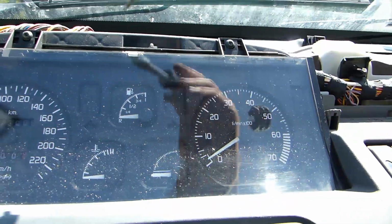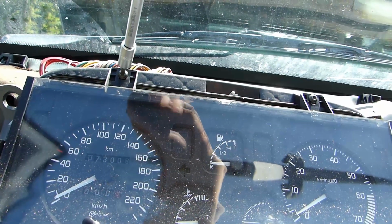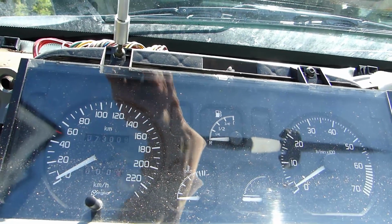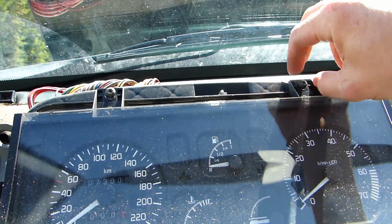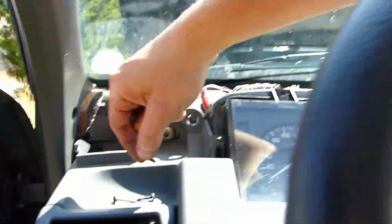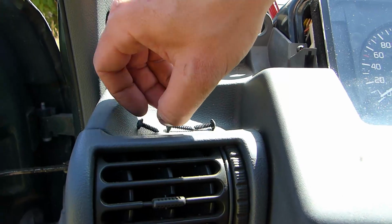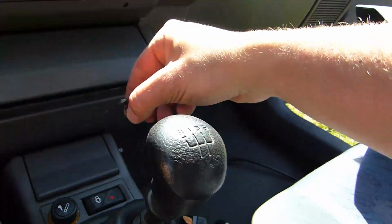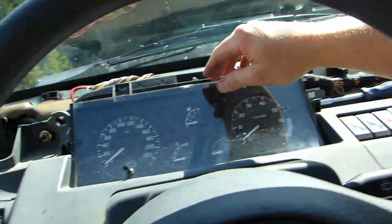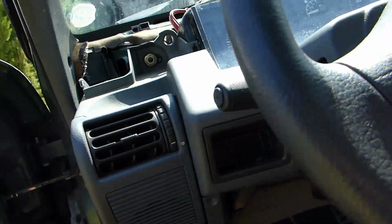And then, see, I didn't lie. There are 2 more screws here. And the 2 other ones holding this part on are underneath. Make sure you keep the screws, well, see how they look, because they're not all the same size. So if you don't want to have adjustment problems, keep them in different places. See, you can move like that, but it's still screwed on underneath.